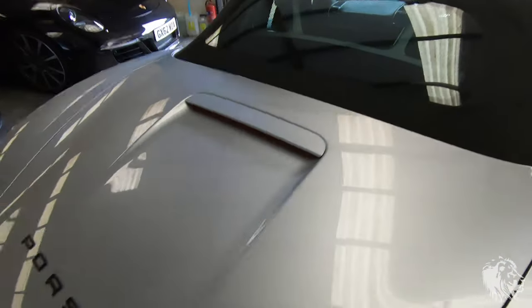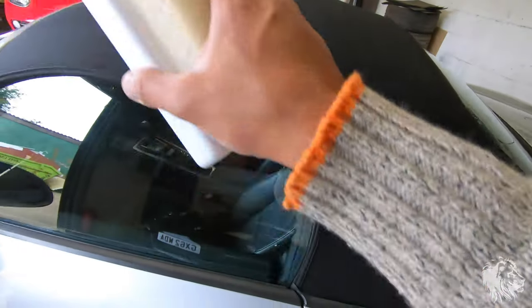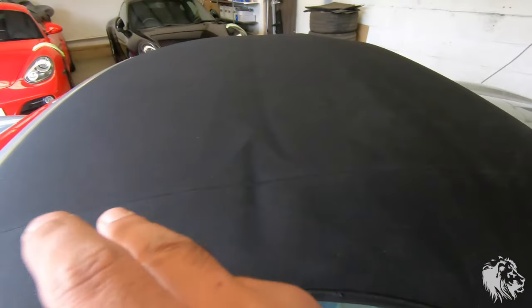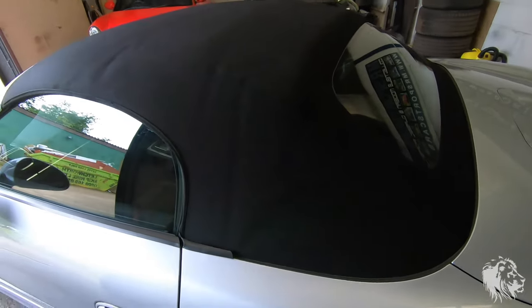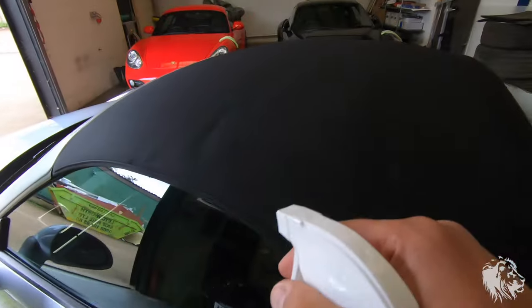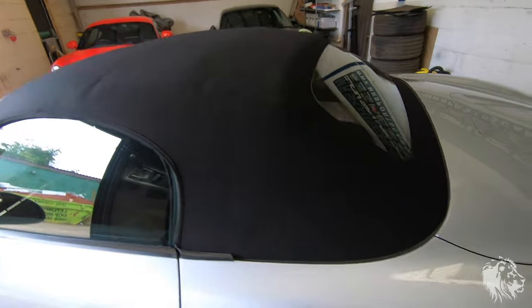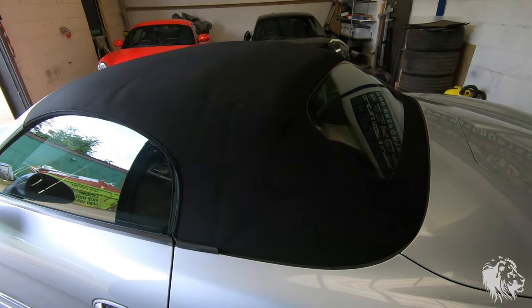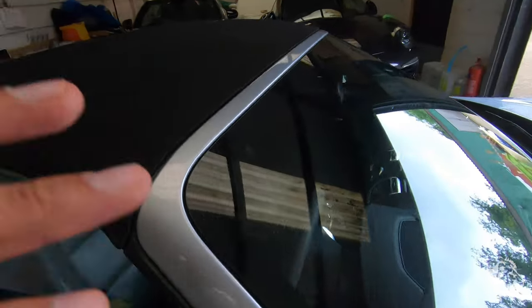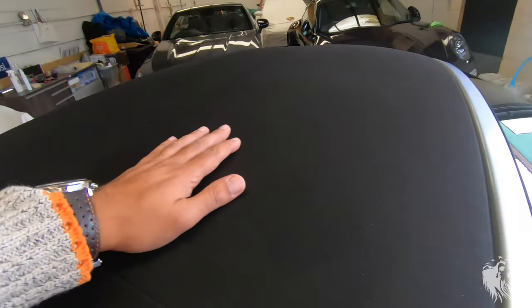Cover the whole hood, all the way to the back. Try to avoid the glass and windows — it won't damage them but it's really designed for that fabric material. Then rinse it out until the water doesn't froth up anymore. Leave it somewhere out of the sun to let the water drain away a little. Then take the other spray in the kit — the soft top protector — and gently spray a fine mist over the whole hood while it's still wet. This ensures you get an even coat of protector. Once it's all dry and set, water should bead nicely and run off rather than absorbing into the fabric.